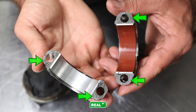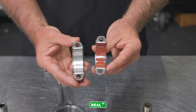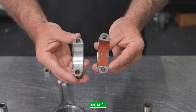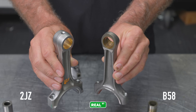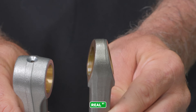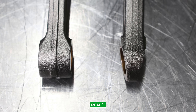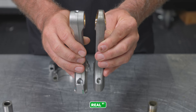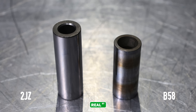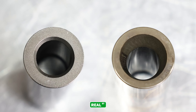The cracked rod design is nothing new — it's been around since at least the early 90s. When these two pieces meet, they basically go back to where they originally were as one piece and they don't utilize a dowel. It's worth noting that neither one of these connecting rods is really field serviceable because you can't resize them — you can't get the dowel pins for the JZ and you can't re-machine the cracked surface. The B58 is a slightly longer rod and they're both a full floating bush design. However, the B58 has a lot of machining done to the top of the rod removing weight. You basically have to lose some weight off the top of the connecting rod because most of the combustion forces are pushing down, and the top of the rod strap only has to deal with the direction change as the piston moves away from top dead center. The 2JZ has a longer piston pin, while the B58 pin has a slightly thicker wall and additional machining removing material from the outside of each end — making it a lighter part without reducing its strength.